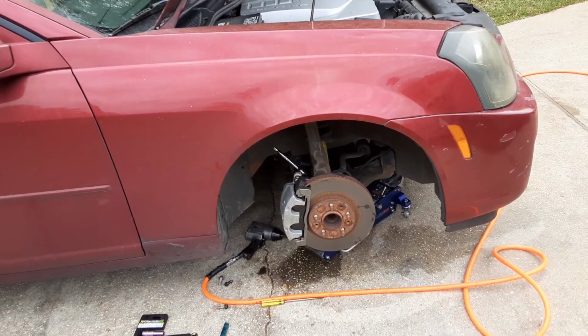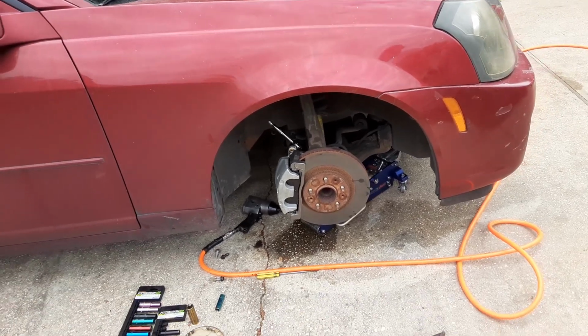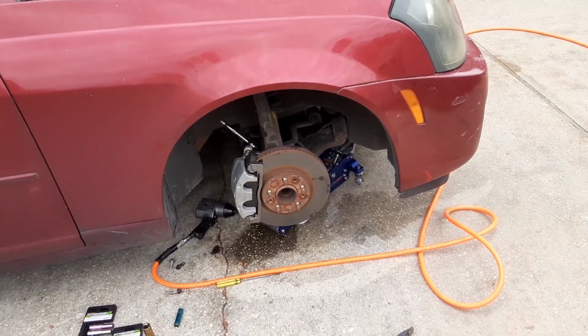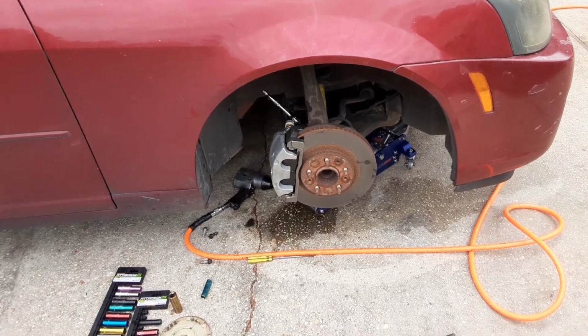to where if you let your brakes get down so low, like under 20%, which hers on this particular car was down to like 5%, even 1%, it will cause the piston in the caliper to stretch all the way out, and over time it'll build up brake dust and particles and stuff in it and lock the caliper up to where you can't use it, and it just locks up on the wheel.